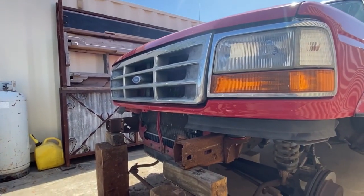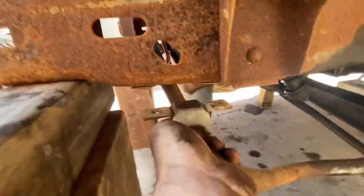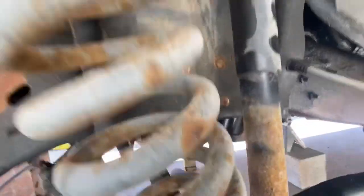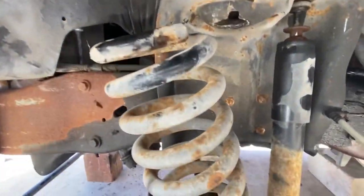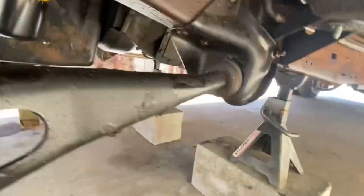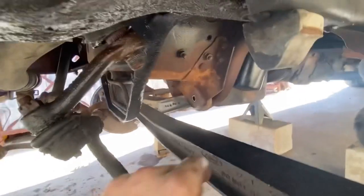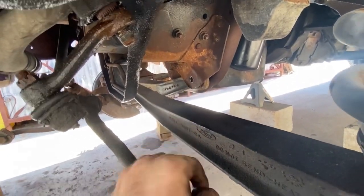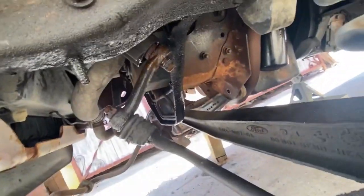Starting disassembly — take your bumper off, pretty easy. Take your sway bar off, it's four bolts and drops down. Snap your coil retainer loose to free the coil spring, take your shock loose at the nut up on top, then take the nuts off the back of the control arm.